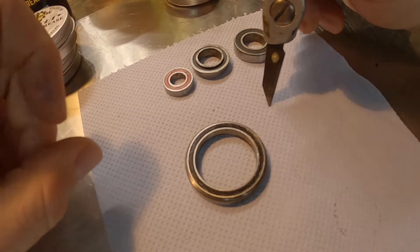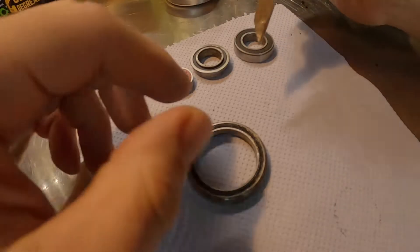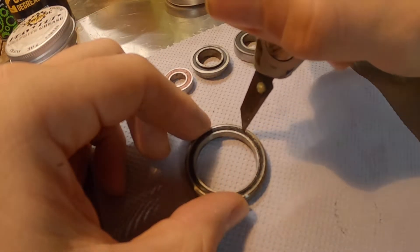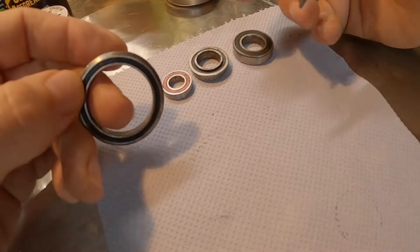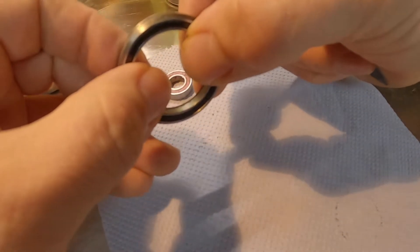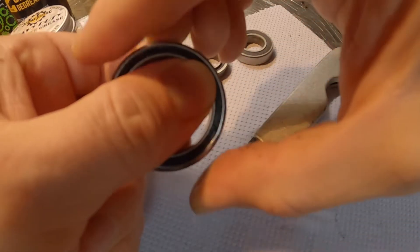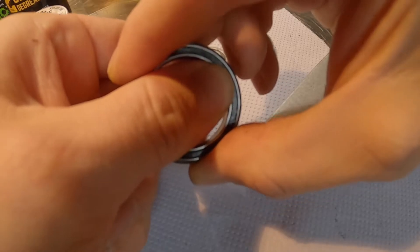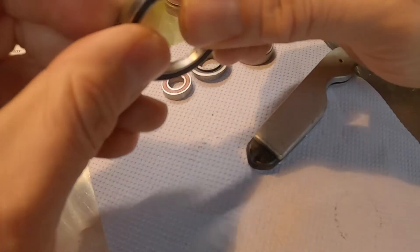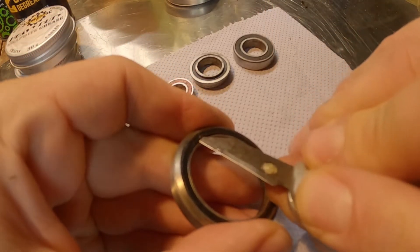What I've also got is some different lithium-based greases. This one here is red lithium — brilliant for these type of bearings, and it's the one I'm going to be using the most of today. There's also graphite grease and copper grease, which just helps seat things back when you've taken them out. You don't really want to use copper grease for rolling lubrication — it's more of a protection thing. Right, I'll set the camera up properly now.